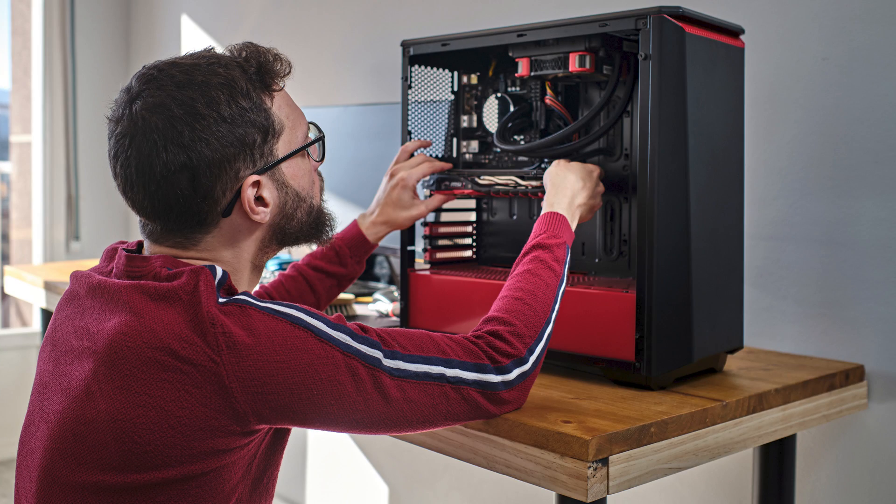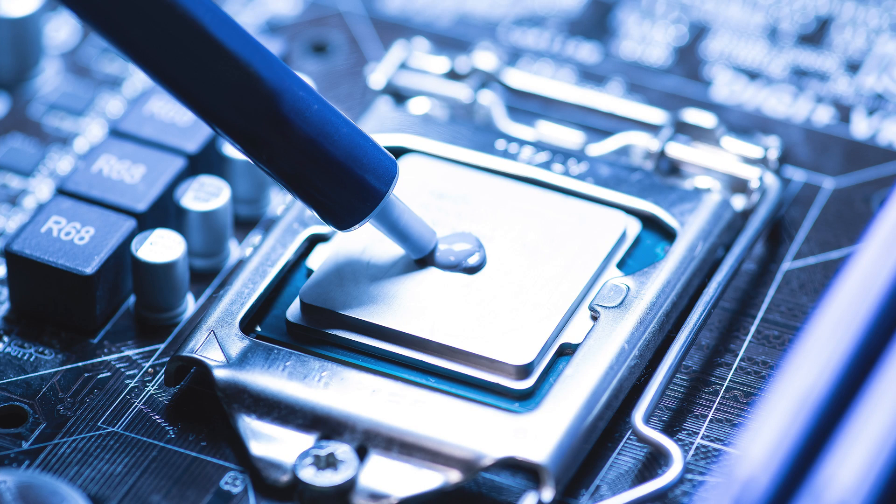If you have other random issues, go through and check to see if everything is still properly seated. Most times for issues like these it's generally the motherboard or the power supply, but as a final check, look at the CPU and make sure that it has enough thermal paste. Some PCs don't warn you when your CPU has caused the BIOS to shut down the PC as an alternative to burning up your CPU. Thank you BIOS — that's extremely sweet of you.